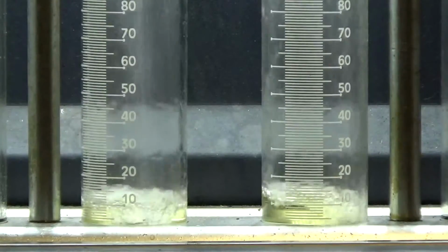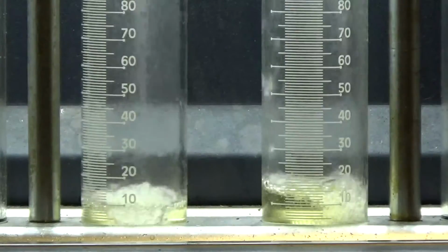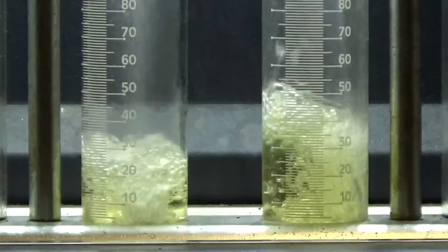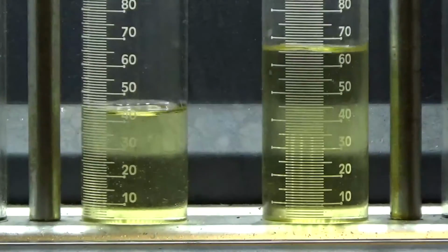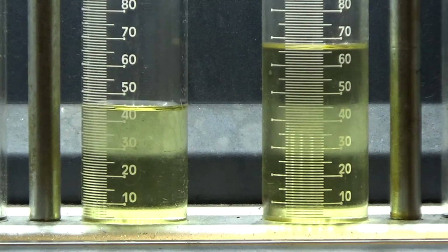1,000 to make sure they're flow matched to the specifications that you need. Here we're doing a test on them at 43.5. The one on the left hand side is 42 pounds. The one on the right hand side is 64 pounds. What we do is all of our fuel injectors are flow matched, and we also test them at 3 bar and 4 bar. 4 bar, which is 58 psi.